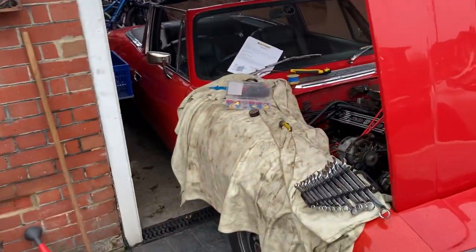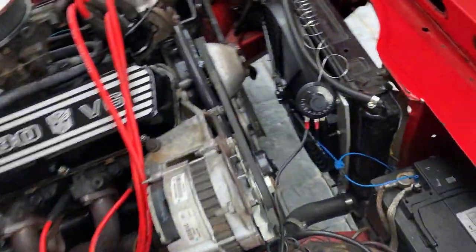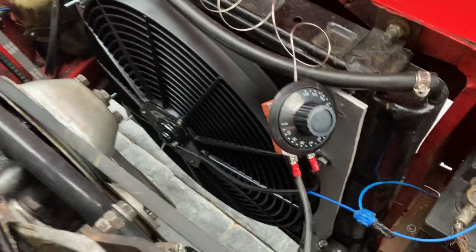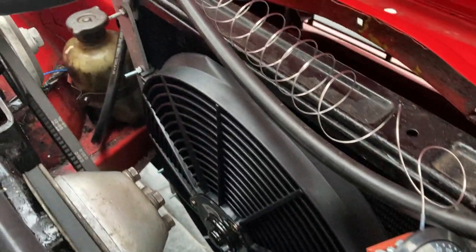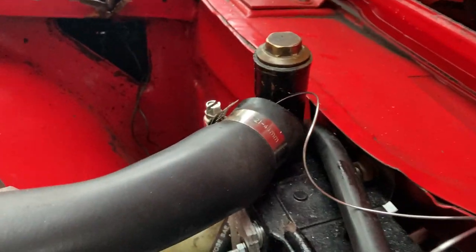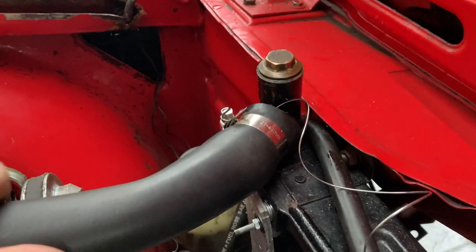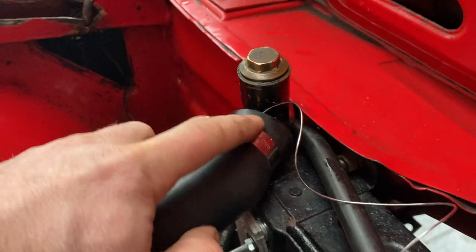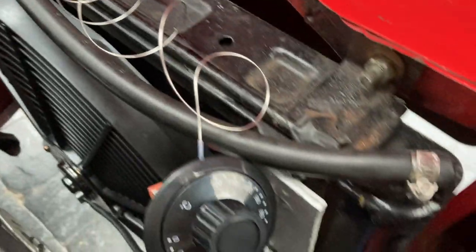It's raining so I've tried to get as much of the car under there as possible. The new fan is on — I made some brackets which all looks good, so I didn't have to poke through the radiator like the instructions said. I got the temperature sensor into the top pipe here as per the instructions, siliconed in, and topped back up with coolant. I'm going to tidy all that up.